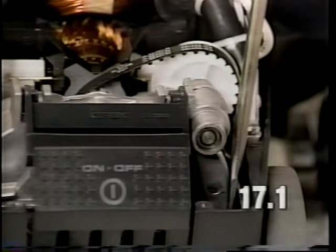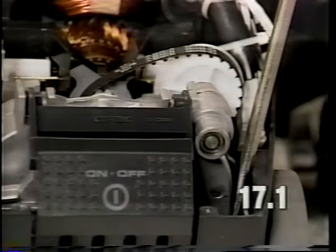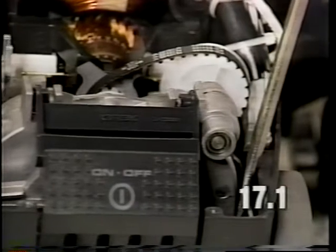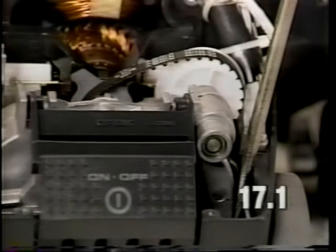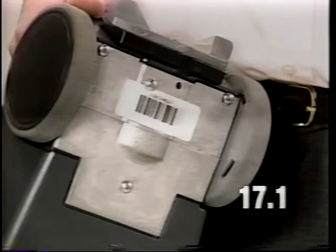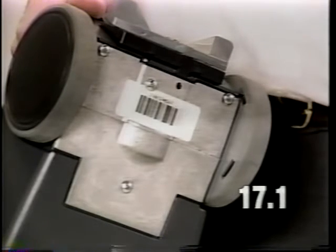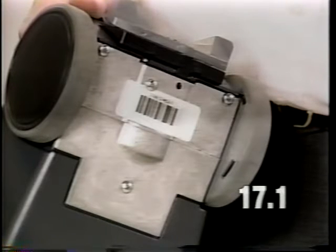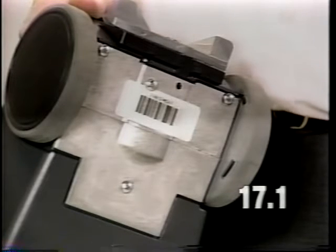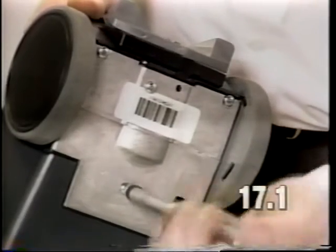Insert the screwdriver between the base casting and the transmission and pry the transmission towards the ratchet side of the machine while tightening your three transmission to base mounting screws. While still applying pressure with the screwdriver at the transmission and base, tighten the three transmission to base mounting screws. The screws should be torqued to 22 to 26 inch-pounds. Tighten the front center screw first.